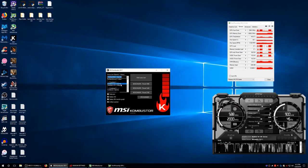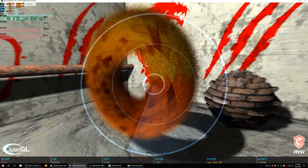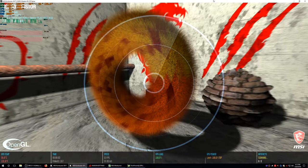I think Test Mark is tessellation. I'd recommend you probably just do the combined test. Since we're overclocking memory, let's leave it on combined because it might test memory too. Let's try 2050 MHz. The OpenGL thing is working just fine for me but I recommend you try the other ones as well — tessellation and combined.